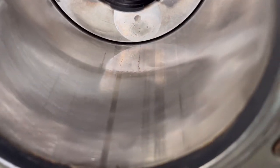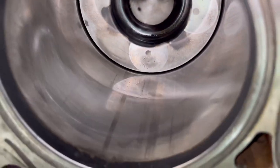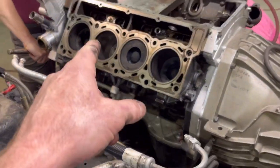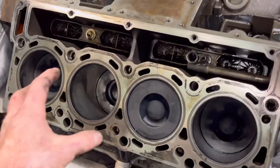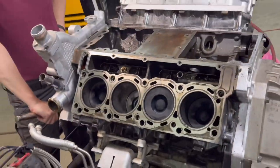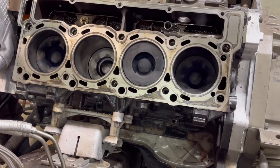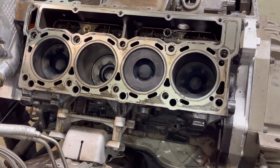Are we gonna rebuild for that? I don't know. Drop a piston in it, ball hone just that cylinder. I've never done that before. I've never ball honed one cylinder with the rest of the engine together. I would probably put a ring compressor over the top and ball hone down into it, just maybe 5 or 6 wipes, just enough to scratch it a little bit. And then new piston, a new ring. We got a piston, ceramic coated. We already got the numbers. We can go back and weight match it. But that's quite a bit.